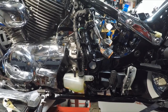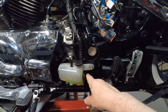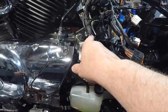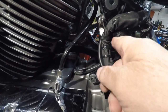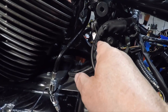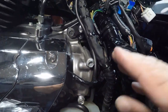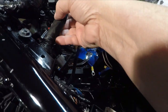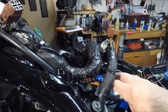I came out today and really got started putting the new wiring in - this is the new part from the 2011. I did all the fuses down here, the box, the rectifier plug, and just worked my way up. The main harness hooks in here and you can pop it out without taking the band off. There's one on each side that pops into a hole in the frame. I've got a lot of it plugged in now. On the other side I have the new wiring right beside the old one - I took my plate off the frame so I can work up through there.